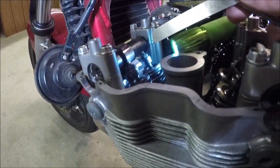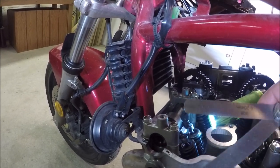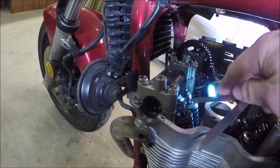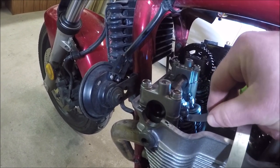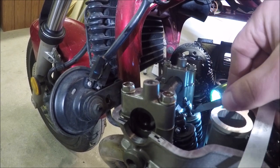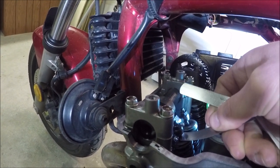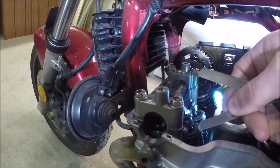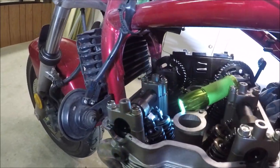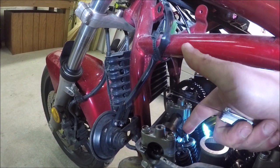To take these measurements on the exhaust, I know I've got to be within seven to nine thousandths. I take the feeler gauges — this is going to be an eight thousandths — and you put it between the tappet and the valve and see if you can slide it in. It's sort of a magnetic feel, that's why they're called feeler gauges. That one went in a little bit easier. So we know we've got eight thousandths on there. Do we got nine thousandths? No, it's not going all the way through. Ten thousandths does not fit. So I know I've got eight thousandths on this one and nine thousandths on that one.